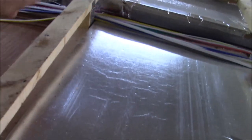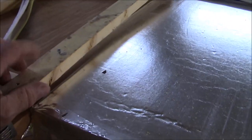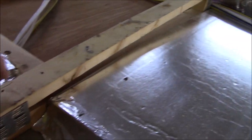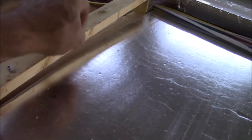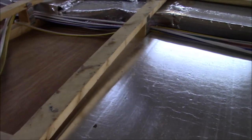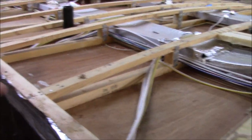Yeah, that's what they use. Do they use nails? No, they use these tiny little screws. They put them here and they put them there. You can't put too many screws on these things because this itself is obviously wood. This is not synthetic OSB. But if you keep putting a whole series of screws, you're gonna split this thing apart. So that's why they put them sporadically. But even doing that, as you can see, there's no glue on any of this. You want to glue these down.